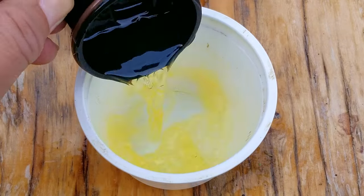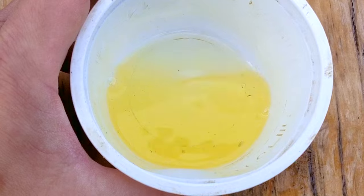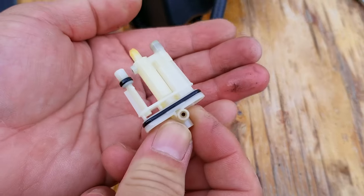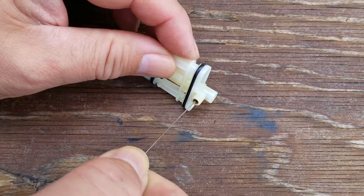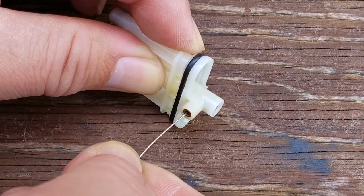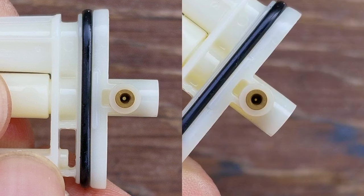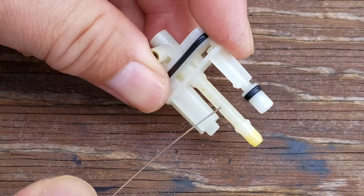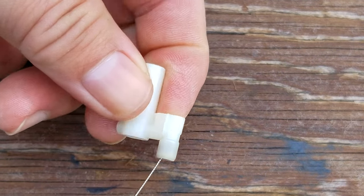I don't see anything at the bottom of the bowl, so I'm going to pour the contents into a different color bowl. Even after doing that, I don't see anything like water that would keep the engine from starting. That only leaves us with the main jet being either completely or mostly clogged. After freeing the plastic cartridge from the main body of the carb, we get a really good look at the main jet. Interestingly, it's not fully blocked — but the engine may not be getting enough fuel. I'm going to use a cleaning wire to clear the jet further. I'll put images side by side to show how much the opening was closed up — I'd say at least half, which would be more than enough to keep the engine from starting. I'll also take apart the cartridge and make sure all the openings are clear. This sort of buildup could take as little as a handful of months, meaning this mower may have been running last season but left with fuel in it — and using ethanol gasoline wouldn't help either.